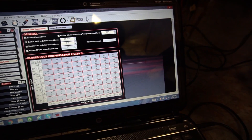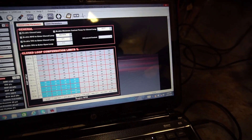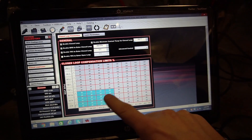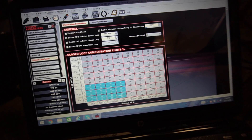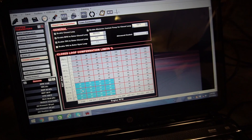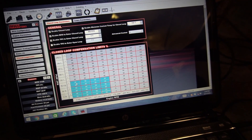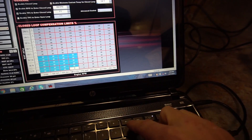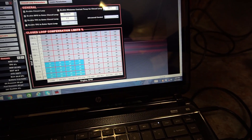Let me adjust this real quick. Go back to 80 on the idle. By putting 80 in here to let it learn up to 80% instead of where I had it at zero for my car, it wouldn't adjust the idle at all. Actually, I don't even know if I want yours to really adjust at idle - it will only go like 15, maybe 20%. We'll see if it likes it or not.